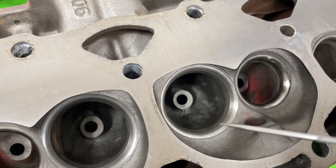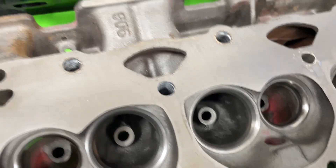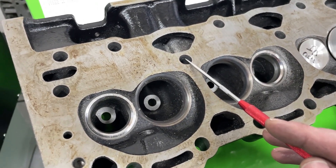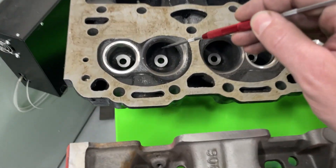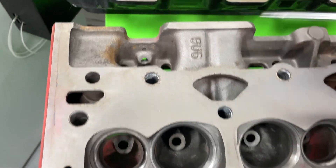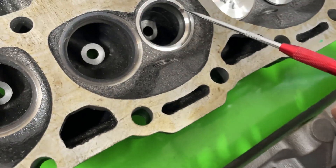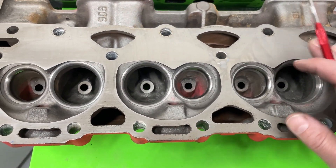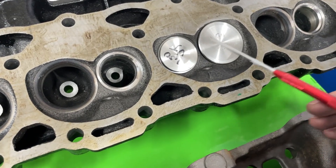That's all that was done — trim the guide, simple valve job, easy-to-do stuff if you've got the machines. This head right here, you've seen in a previous video — this is actually a Pro Comp slash Speedmaster Vortec head. If you look at it from the chamber side, they look very similar. But as you can tell, there's a lot more material around this guide boss on both the intake and exhaust than the stock Vortec. Also, looking at the valve job itself — these are hardened seats as well. He did do a 30-degree back cut on the intake, no back cut on the exhaust. This one actually has a back cut on both the intake and exhaust when it flowed.